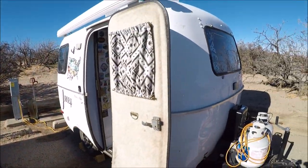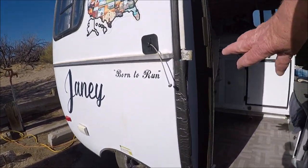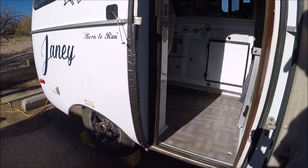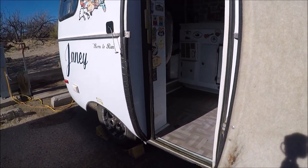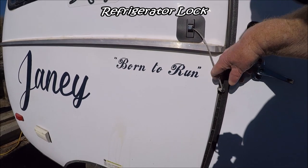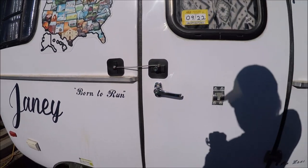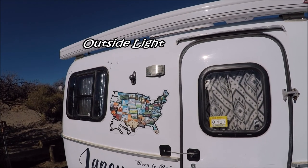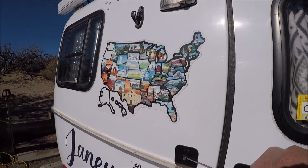Over here, you can see I've had curtains made for my camper. Over here I put insulation, because on a Scamp the door doesn't close all the way — it usually has a gap, so I got some foam insulation and put it on there with duct tape. Also, a Scamp door can sometimes fly open, so I put this little extra lock right here to keep the door from flying open. Even if the handle comes open, the door can't fly open — that really helps a whole lot. And right there I put a hook where I usually put my solar shower, and of course I got my little map right there.